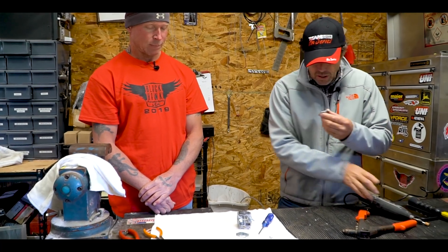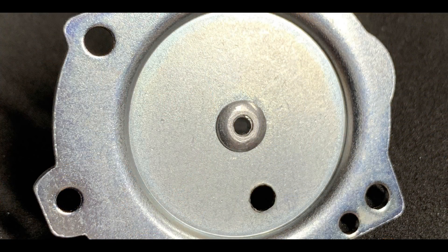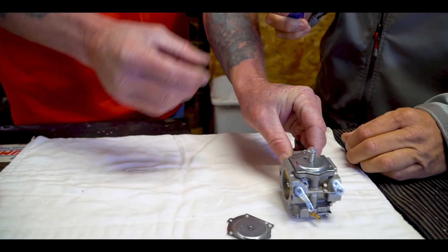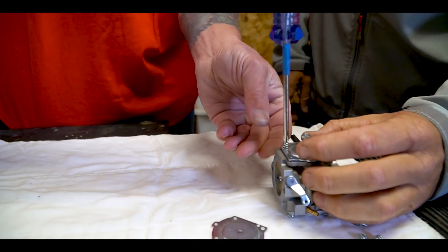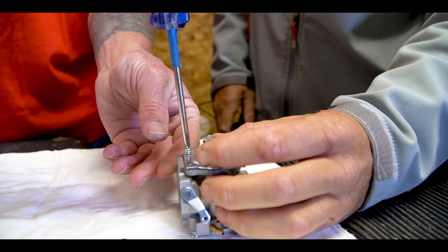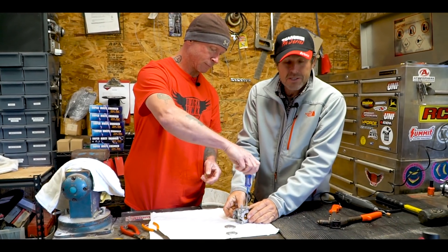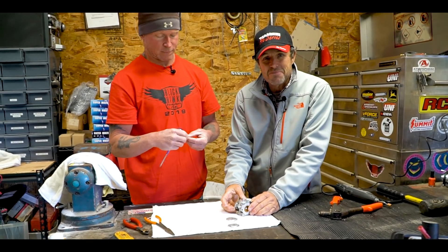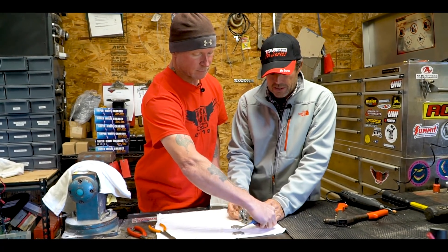Basically all you have to do is make sure that all the particles are gone, there are no rough edges, and the button works good. Then just put it back on and install the four screws. You don't need to put monstrous torque on these — just snug them down; they are a small screw. Remember to bottom out each one and then go around and tighten them. This is a very easy operation, it's very functional, and something you can do yourself on your paramotor. Obviously we took the carburetor off, but you don't have to — all you need to do is take the cover plate off.